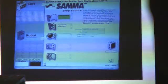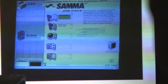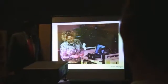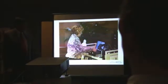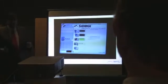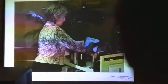The operator is prompted through a series of visual steps to make sure the case isn't cracked, the tape pack looks okay, and it's the right tape in the right box. If there's an existing barcode, you scan it, or you can type in the ID from your database if you have one. It prints out a barcode label that goes on the tape, and then another equivalent label for the box. It takes about 30 to 45 seconds per tape. Now the tape is ready for automated migration.